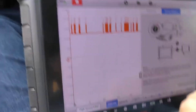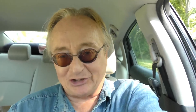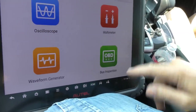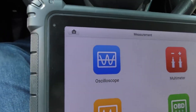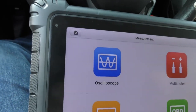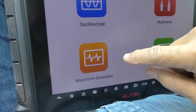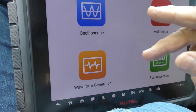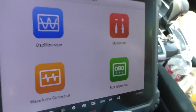I can't even show you all the data on the different CAN systems — this is the CAN H6, we'll switch it to the CAN L14. It's absolutely insane what this thing can do. This particular section lets you check through all the CAN bus to see if you've got a communication problem. It also has an oscilloscope so you can pinpoint individual ones, a plain old multimeter, and even a waveform generator. So if you think a sensor's bad, you can generate a waveform, watch the sensor with this device, and see if it's activating or not.